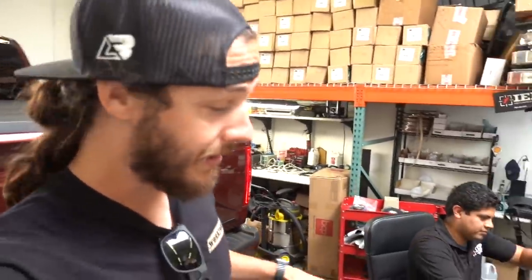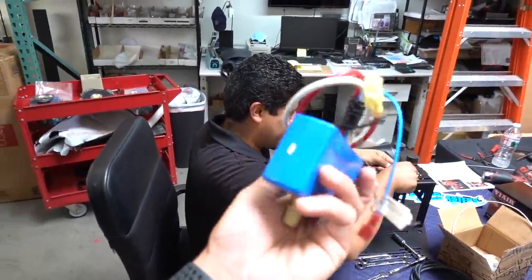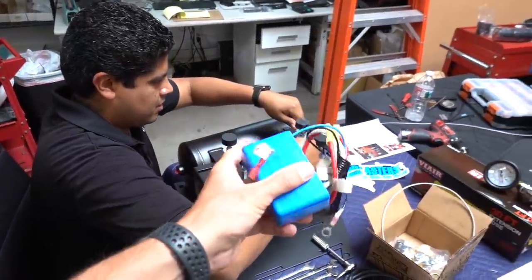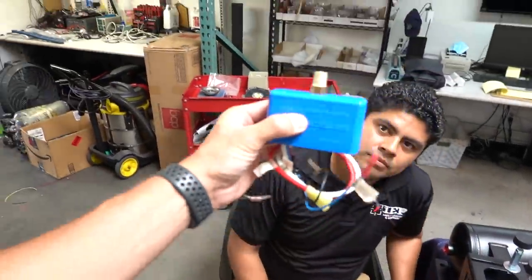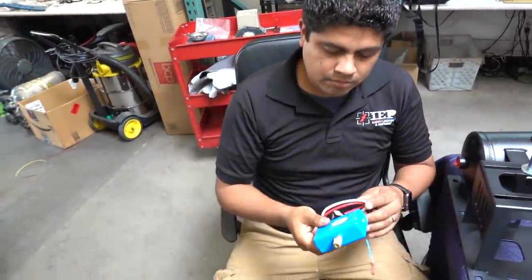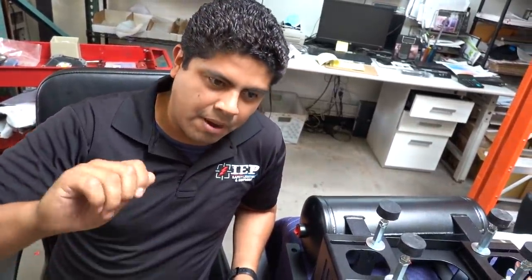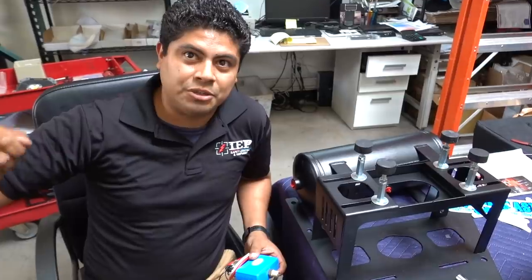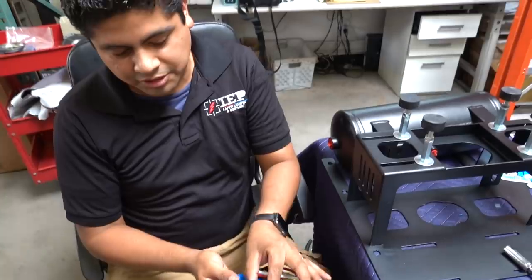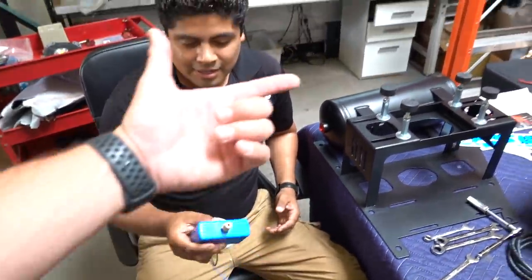The tire inflation kit comes with a little tire inflator from Viair as well as their little extension curly-Q hose. This guy went full bore on this kit. One thing I noticed — being this is like the micro kit — they put in this giant pressure switch. What a pressure switch does is it tells the compressor to turn off when the tank has reached a certain PSI. This one is rated at 150 PSI, but Sergio noticed that this thing is ginormous. Normally you need your pressure sensor and a relay to make everything work because the power you need to activate the whole compressor is a lot, so you cannot use the power from your ignition directly.